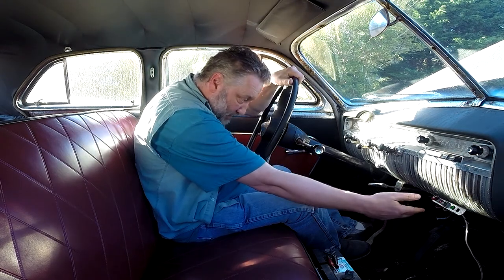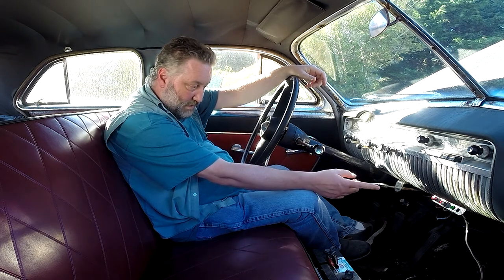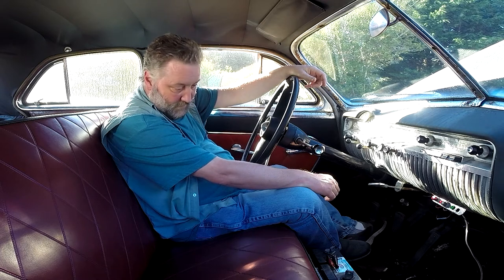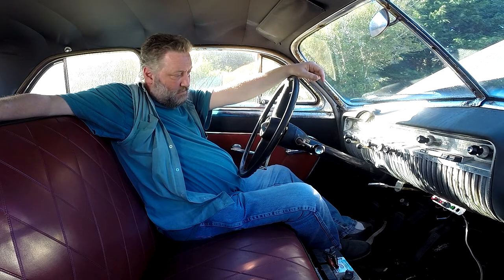What I'll do is drop this whole panel and have a look behind it — right now it's kind of a mess. It's simple enough that I think I can work it out, though I don't know what the red and the green indicators do; one of them is probably the ignition. The bulbs may be burned out anyway. I do have a new — the fourth — ignition solenoid that I bought out west here. I don't know whether they all come from the same factory, but it's physically stamped '6 volt' right into it. I believe in the studio a couple of years ago I did hook it up to a 6-volt battery and, if I recall, it did activate and stay down. So I'm hoping that replacing this one will at least take care of the need for the 12-volt workaround.